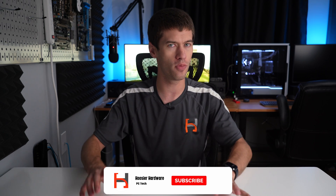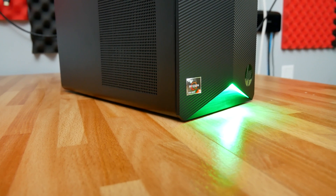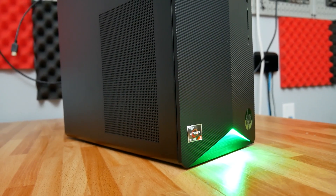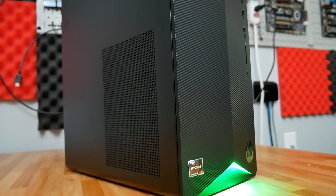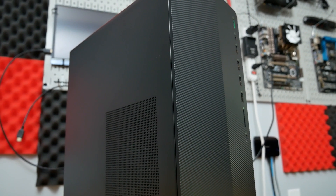To get started, let's assume you have an HP Pavilion or a Dell G5. Both PCs have the exact same set of flaws. The first one is their case has absolutely no airflow whatsoever. That's actually probably okay because you can't really put upgrades into the case anyway, but all the components inside those chassis are going to run warm. While some components are likely running well within spec, cooler temperatures are always better. But that alone isn't the major flaw — I could get over some poor airflow with worse-than-normal temperatures and possibly a tiny bit of thermal throttling at the very high end of demanding games.